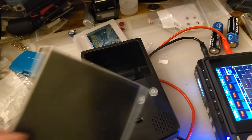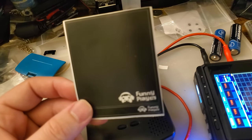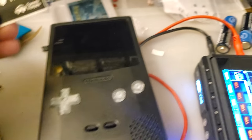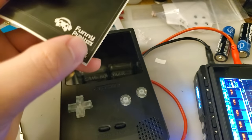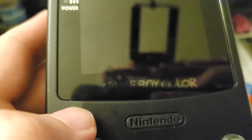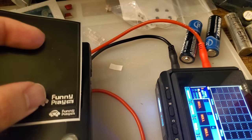Oh, sorry, quick addendum. This thing. You saw me pull it out at the beginning, and then I proceeded to absolutely never touch it again. I still am not 100% sure what this is for, but speculation leads me to believe it is for light bleed on the LCD, given the size and cutouts. I didn't use it because I had an opaque shell this time around. But I'm guessing this big sticker is for the back of the screen, and this little sticker is for that little bit in the front. If there is a little bit of a gap between the shell and the lens, you might see some screen through there. You can use that little sticker to block that out. It's kind of silly if that's what that's for, that they put their logo on there, because you might see that through the gap as well, but it is what it is.